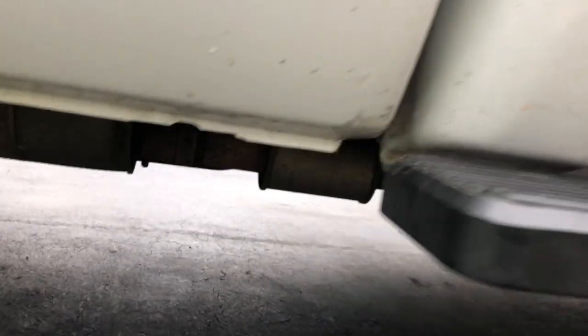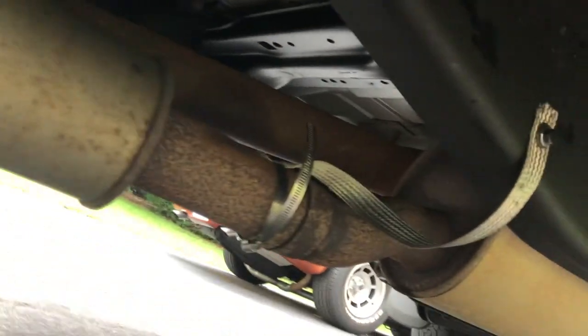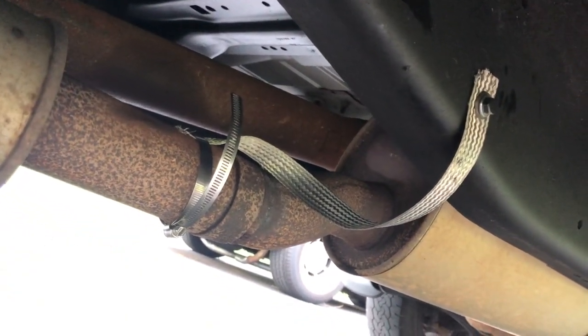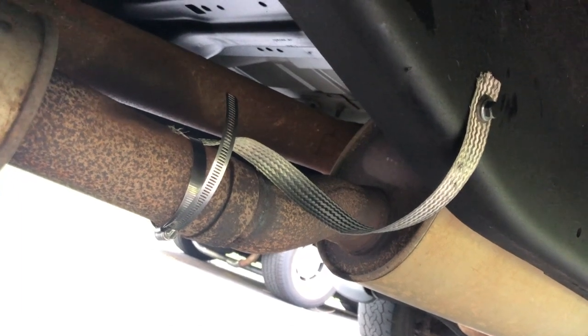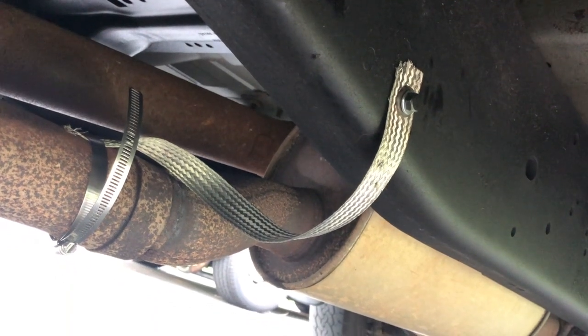This is the spot I was able to get the braid — in the center of the exhaust system. I used a hose clamp and sanded that pipe to get the surface rust off it. Hose clamp onto the pipe and then bolted into an opening that was already in the frame.